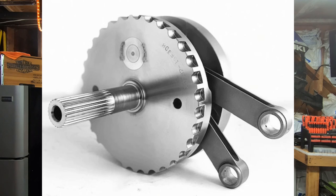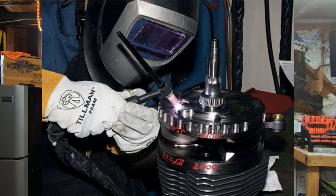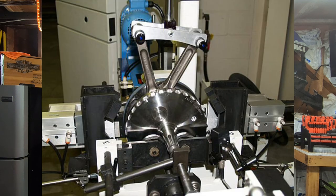If you have any of those signs, don't ignore them, because you're headed toward catastrophic failure. The only true fix is to completely replace the crankshaft with an aftermarket piece, such as from Dark Horse or S&S. Alternatively, you can take the factory crankshaft to a qualified machine shop — they'll be able to pull it apart, balance it, weld the flywheels so they won't spin, and true the crankshaft up using the correct stands and jigs. You may want to weigh the cost between buying a new crankshaft versus having a machine shop true up your existing one.